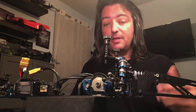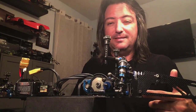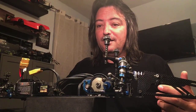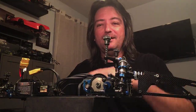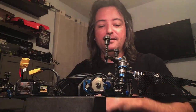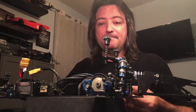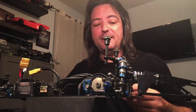What am I missing here? I'm running a gear diff. The gear diff that's in here, I have 60K in it. I thought it was light, but it seems to, hey Dan, hey Lisa. I thought it was going to be really light, but I think when you have too loose of a diff, the car will kind of walk on the high end when putting down a massive amount of power. It wasn't walking on the high end at all, so I think the diff was stiff enough, but if it's in error, it's probably light. I might go a little stiffer on it and try it.